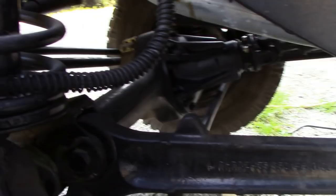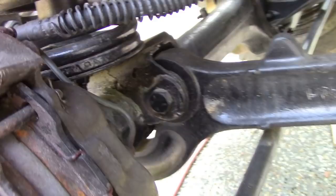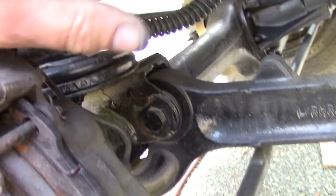The second top tip is once you've got the radius arm out and you've got these little wing things - you've got one at either side and another one at the back of the mounting points - get a hammer and ding these out just a bit, maybe two or three millimetres, and it will just drop in. Then you get a podger bar, like a tapered punch, and wiggle the bars about, and you'll get that to line up beautifully. You can do it on your own, easy and safe.